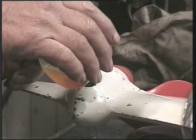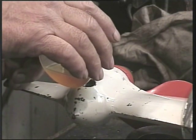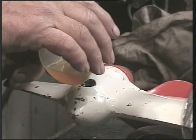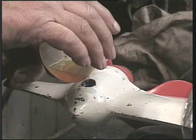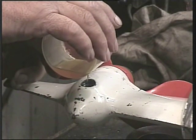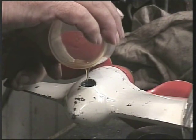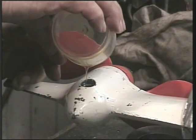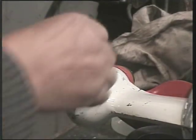It's the easiest way to do it. Just take your time. There's no secondary bung to fill it to. These are usually filled vertically, so you can't put any more in. In other words, you don't fill the entire gearbox up. But as this has been low, we'll just keep an eye on it. You can actually take some more. It's quite low, very low. Anyway, that should be a lot happier now.